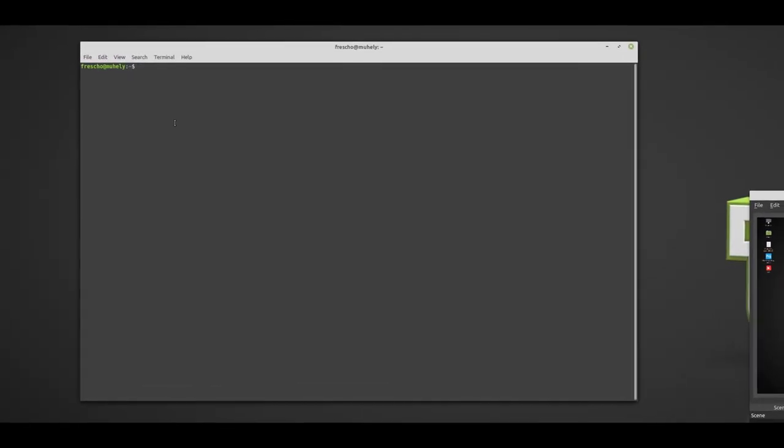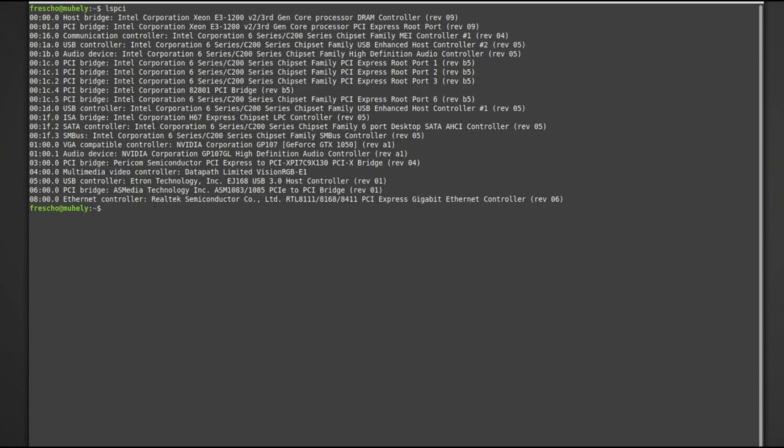So what I check first is if I can see the card. Oh, cool, it's here, so it's connected. Let's check the so-called driver. Oops, it's not loaded. I think it is because I had a kernel update recently. I have to recompile.